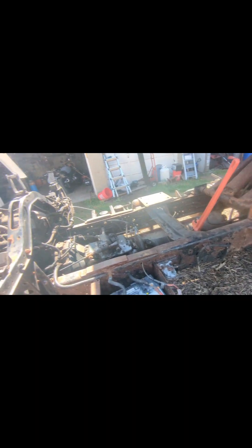You can see my lines there — they're not quite lined up, they're about an eighth of an inch off. I just tightened up these nuts and got it set exactly where I want to try it first. Just an eighth of an inch advance, tiny fractions at a time. Don't get the disease of more when you do this — don't do big changes at once, you could screw something up. Seems more intimidating than it actually is. Super simple on this truck, just two nuts, 14 millimeter.